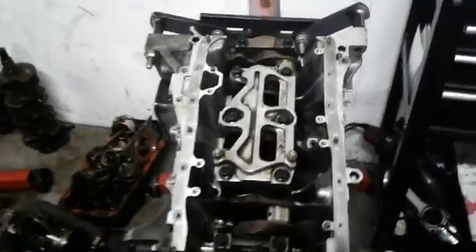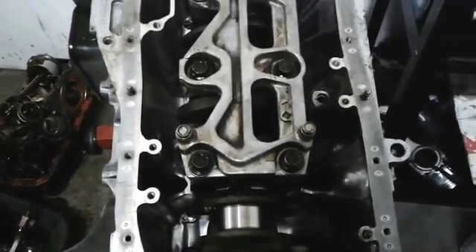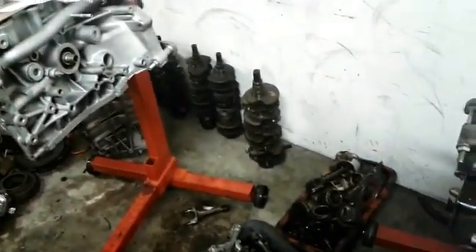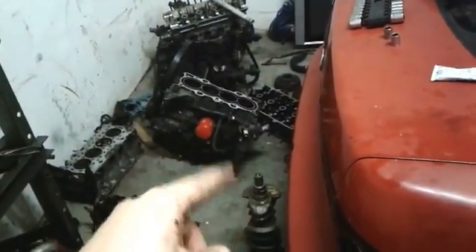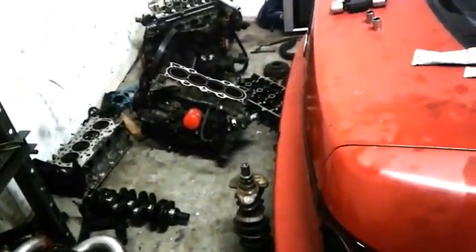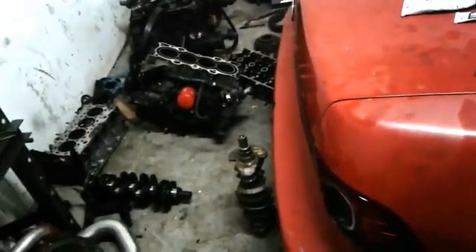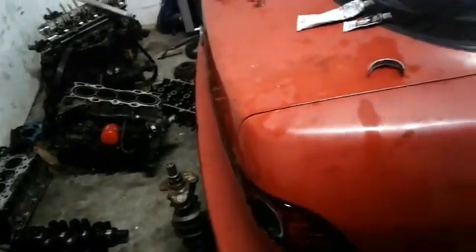Alright folks, this is going to be it — I'm going to wrap it up for the day. Everything's in, spin's good. Tomorrow we'll come back and I will probably finish my poor man's GSR and put pistons and rods in here. On a good note, I was able to get the head off that one — if you guys were tracking before — with the ones that were stripped. The head bolts — a friend of mine loaned me some stripped bolt remover tools, because the set I had didn't have the right size. I got to it and it came out pretty much right away. So I'm holding out hopes that one has a good crank in it. If it does, I have a build for that one too.